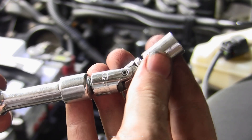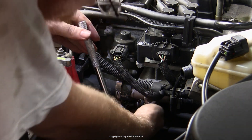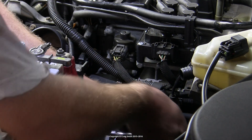You go under the coolant hose and sight the bolt heads from the right angle from above with a flashlight. Once you've got your ratchet in place you can crack them free — it's a little bit awkward but just work at it, it is possible.